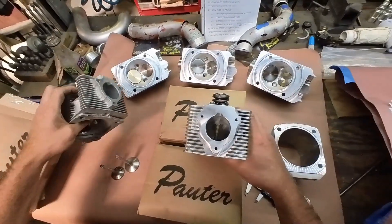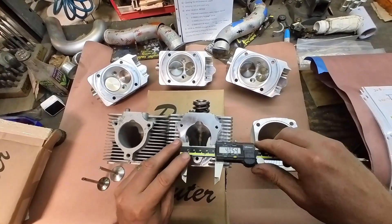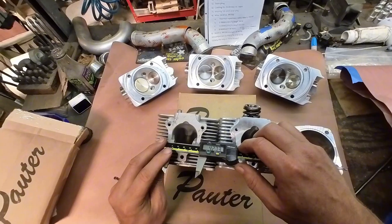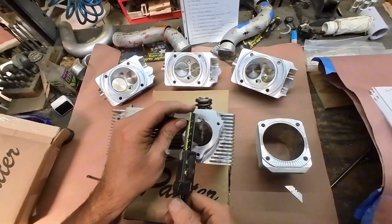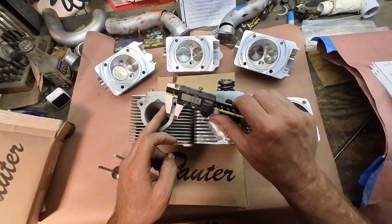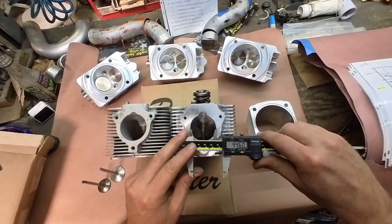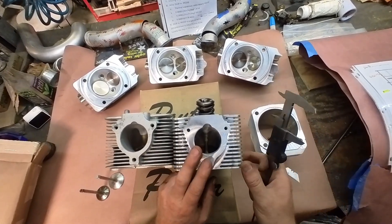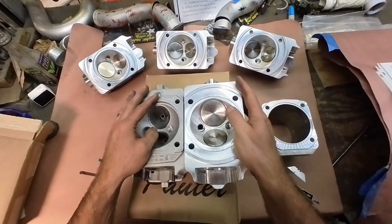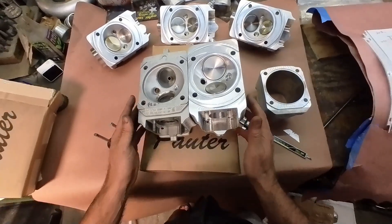We went with standard inlet size on the ports. They're very close — the casting on the turbo is actually slightly larger, within three-quarters of a millimeter — but you can see they've left a lot more meat on the side here to run much bigger ports. On these same cylinder heads he'll run stock ports at 41.5mm, or Euro RS ports at 43.5mm. We sized these cylinder heads up to match the ITBs that Ivan was getting made. For a turbo engine, we don't really want massive ports anyway. There's no reason to compromise the low-speed to pick up the top end when the turbos are going to be taking care of the top end.